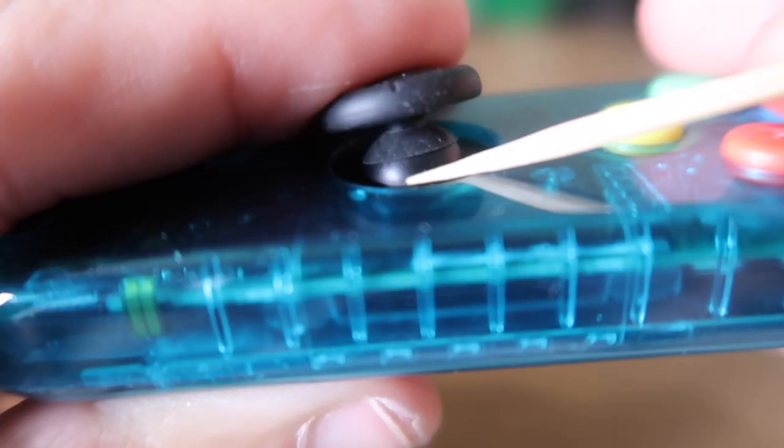There's a second thing that may have caused it: after some people opened up their Joy-Cons, they found that inside the Joy-Con just underneath the thumbstick there is lots of dust and dirt, and that may be causing the drift.